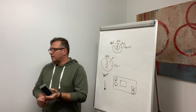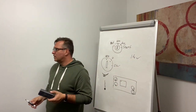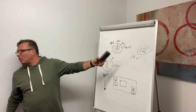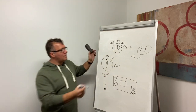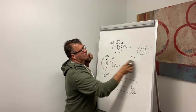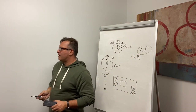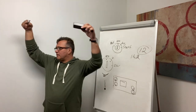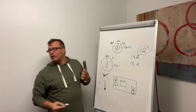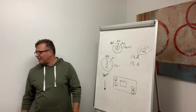What is the voltage in the truck system? It's 14 volts. It's normal voltage. It's 12 volt batteries. When batteries are new, the normal reading on the voltmeter will be 14.1 or maybe 14.2. That means batteries are okay. The older your batteries are, the lower the voltage. When voltage drops to 13.6, this is the time. Do it now or are you going to regret it? 13.6, yes.